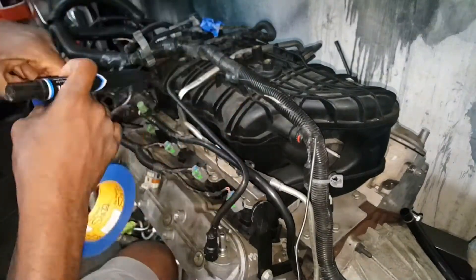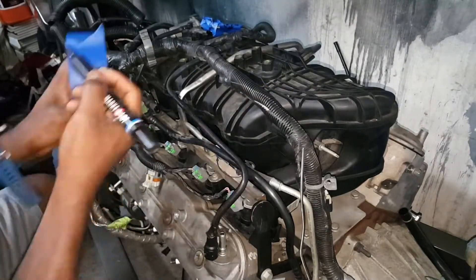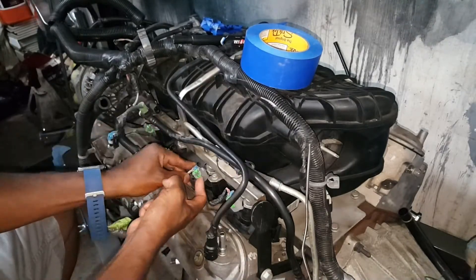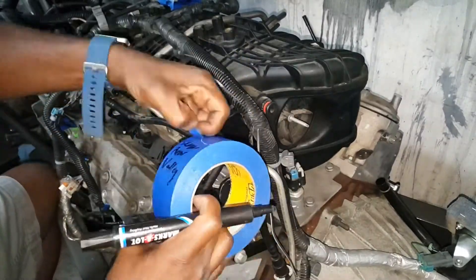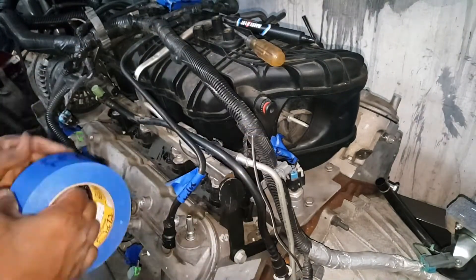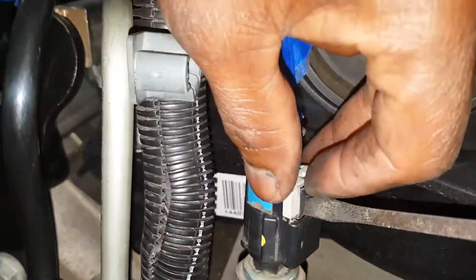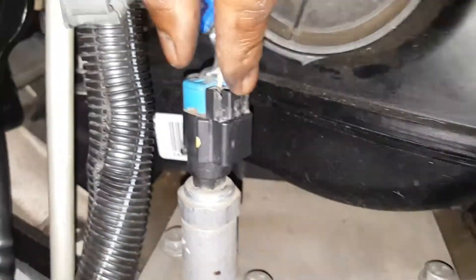More than likely I'm gonna keep this intake if I can get it to clear the hood. Right now I'm labeling the MAP sensor and the injectors. I'm going to zoom in on how to actually take off those injectors - you just put the clip up and it comes straight off. That valley sensor - I'm not sure of the exact name - sits right under the intake. You just push that clip up and it comes straight off. That little black wire is the ground; make sure to put that back on the grounded block.